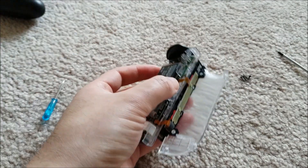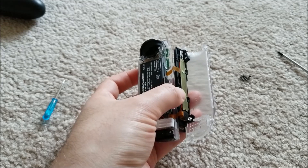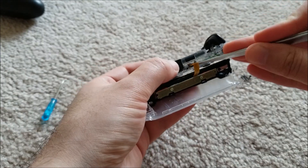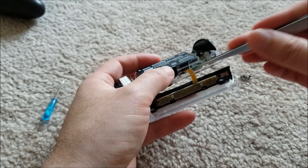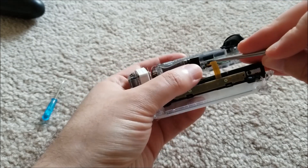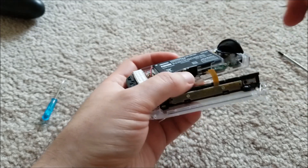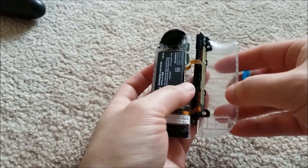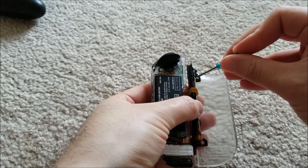You can actually do this without detaching any of the cables but it is quite difficult. There's this cable here on this side which goes to all the LEDs and the shoulder buttons. To remove that you'd have to unclip and actually remove this mid-frame assembly — there are a couple screws — but I'm going to show you how to do it with it attached because it isn't that big of a deal.